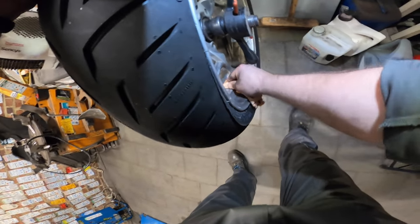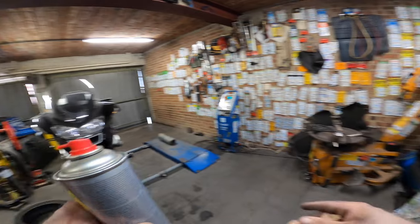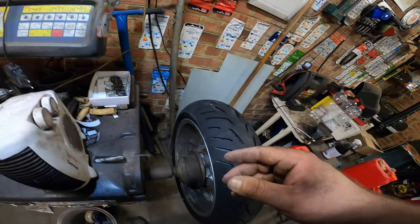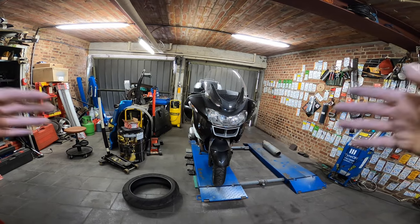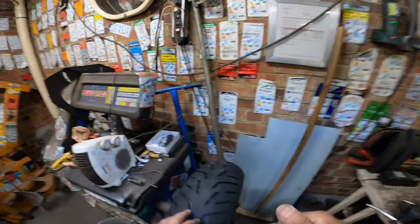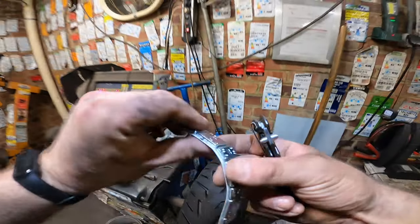as your motorcycle will not tremble because this is the rear wheel, but an unbalanced rear tire is not good for your bearing, is not good for the chassis. Everything will be trembling and the chassis will catch those trembles from the wheel, and the force of the trembling will go through the entire motorcycle, creating stress in the chassis and possibly tires and brakes. Pretty important to balance your tires. Pretty important to watch my videos, of course.